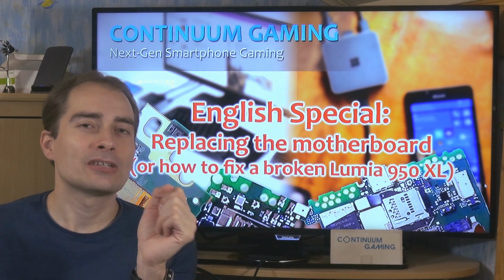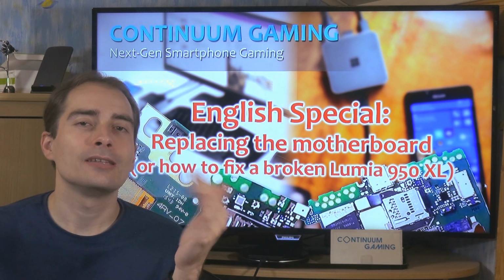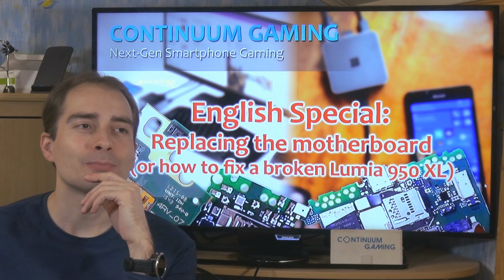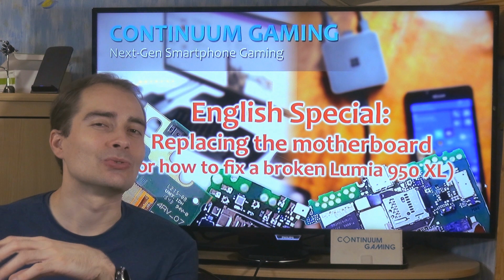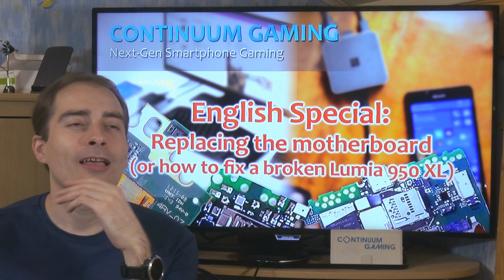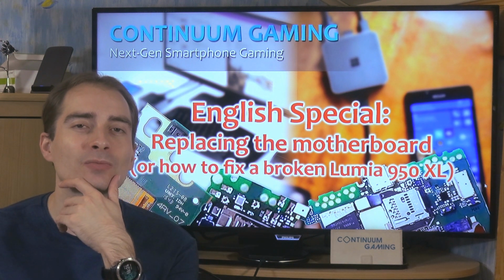And after a while I couldn't free up any more memory, and so I thought, hey, why not try to use a partition manager on my Lumia 950 XL and try to decrease the sizes of the different parts there. And that alone would maybe have been functional, but the problem is I had to more or less shift those partitions too, and shifting wasn't a good idea, especially because my smartphone's battery was really low. It took a couple of hours to do that, and when I woke up I thought, hey, now it has to be done and everything should be fine.